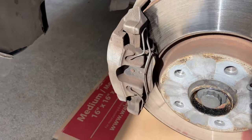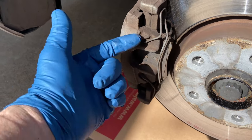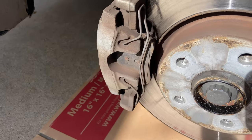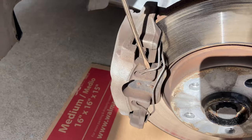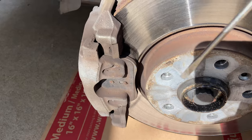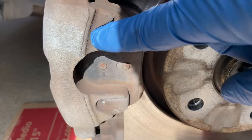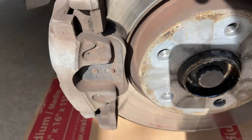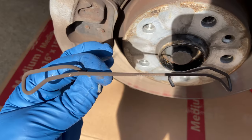Back down at the wheel — there's a tension spring on the front of the caliper. Just take a screwdriver and pop it out; it comes out pretty easily. Watch your face and be careful. Notice there are two holes in the caliper where the spring seats — remember those, because we'll be putting the spring back in when we're finished.